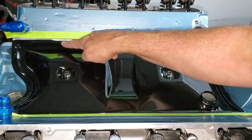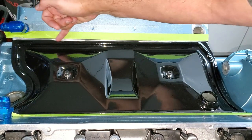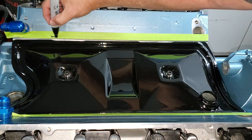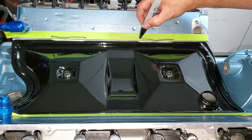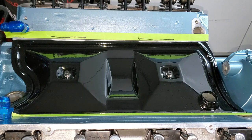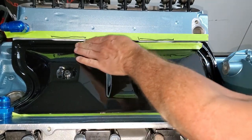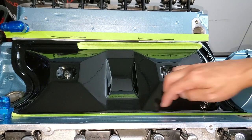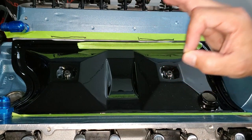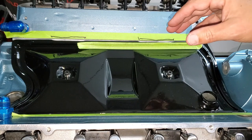It is bolted down. Now you can clearly see the gaps — go around and look at how much RTV you might need in certain places. I can tell I'm going to need a little bit more here and a little bit more here. Take a pen and mark on the tape to give you some guidance when we put the RTV down. Additionally, if you want to do another trick, get some tape and tape off the top side as well — go all the way around. When we do the RTV I'll show you another trick, we can take the tape off and it'll be a nice clean line, just like caulking your toilets.